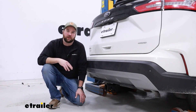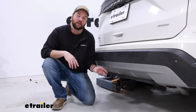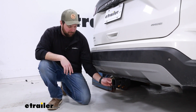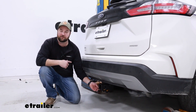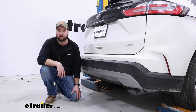Adding a four-pole trailer wiring harness to the back of your Edge is going to allow you to safely transfer the four-pole signals to your trailer. The four-pole itself is going to include a ground wire, your tail lights or running lights, and then your stop and turn — your left turn, right turn, and a combined signal to make your stop signal.